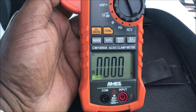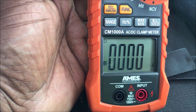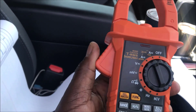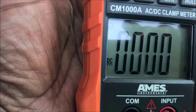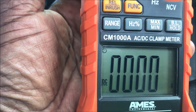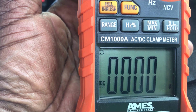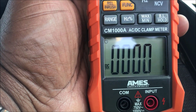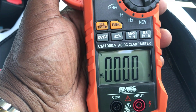Make sure it's on DC because we're using DC amperage. You just put your clamp around the negative or positive lead. If you put it around the negative, you're going to get a negative reading — it's just reading backwards. So if it's running a hundred and seventy amps, you're going to see a negative sign in front of it. Swing it over to the positive and you're not going to see that negative sign — it'll still read a hundred and seventy.